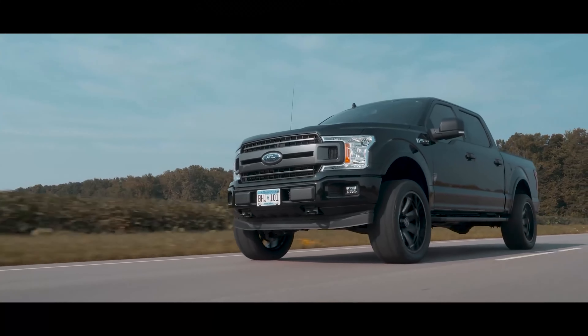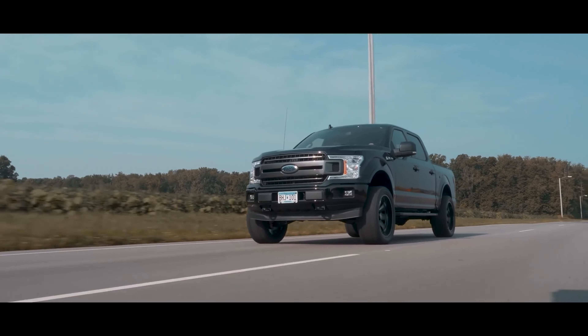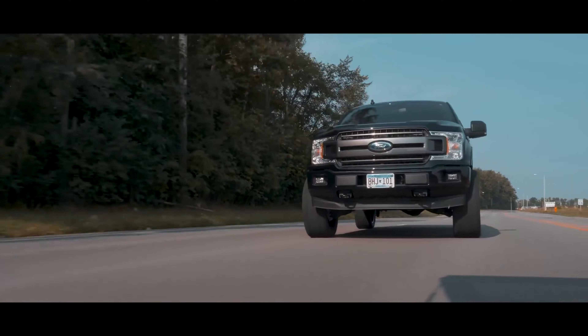For some reason, in 2015, Ford put crash bars in the front wheel wells behind the front bumper, only on the crew cabs, but every other year in the 13th gen body style will have crash bars. So depending on how large you're looking to go, it's probably gonna rub a little bit on these crash bars. And while I can't legally say that they can and probably should be removed to fit larger wheel and tire setups without rubbing, we may or may not have done it before, and you'll be okay.